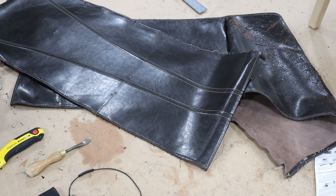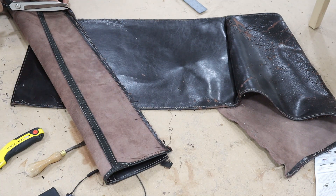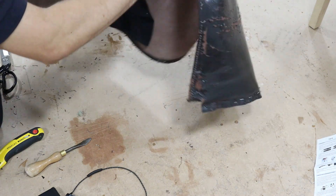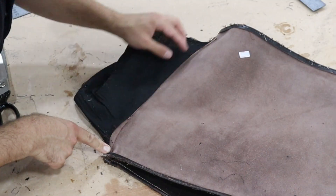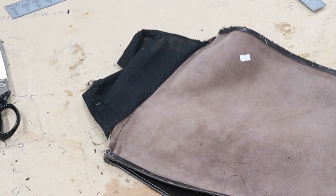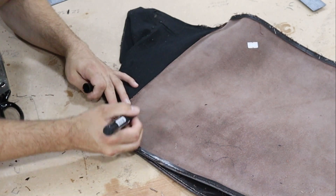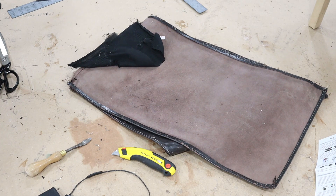That's the outside back — I've got my nip mark there, and I'd copy that over by folding it to make sure it's all lined up. The inside back has a slight curve in it so we'll undo this and copy it. You can see where the fly started. A fly is a piece of fabric used to extend any part of the upholstery — the inside back, inside arm, or seat. It can be in the same fabric or an old fabric. Flies are used for two reasons: to make fabric longer, or to pull down under a rail and be stapled off.